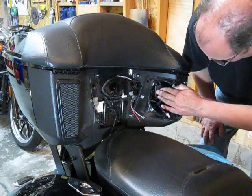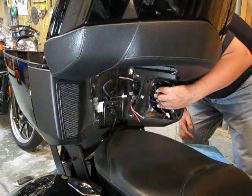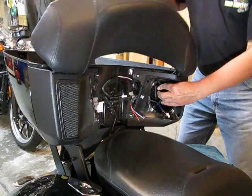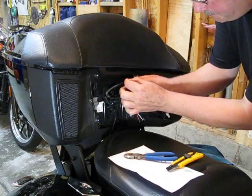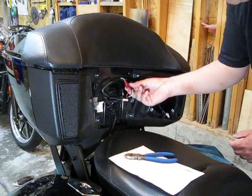I just put some hot glue on the edge of it, and I placed it in a way that I can verify that the switch is in the center of an access hole. This will give me access with a small screwdriver to adjust or change the flash pattern if I want. The white wire with the pink stripe is my brake line. I'm going to cut right in the middle of that wire, strip it back, and use my POSI-LOK connectors provided to tap them into the module as per specifications.